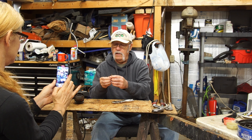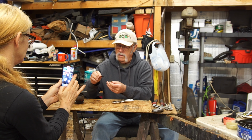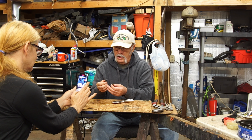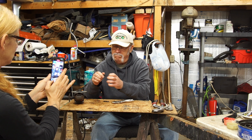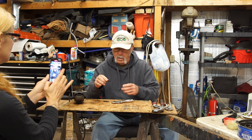Okay. There's a bunch of these studs in a slant 6 head. Probably in other heads, too. They're along a machined surface, and you have to get all these studs out to clean the machined surface. Where they're screwed into the head, they go into a water jacket, so there's all nasty rust and everything down in there. So when you try to unscrew them, they don't come out.